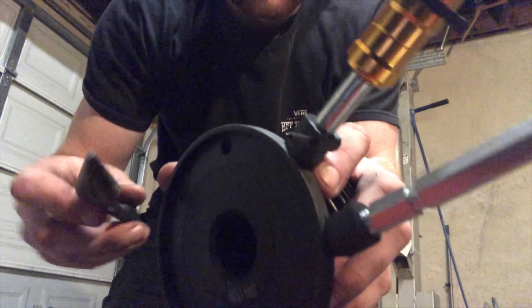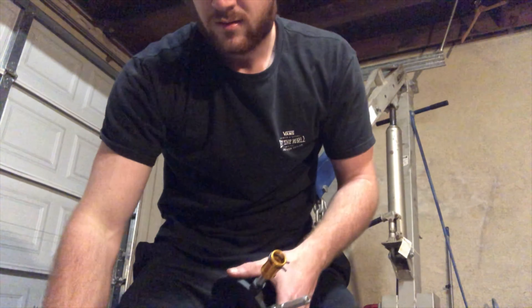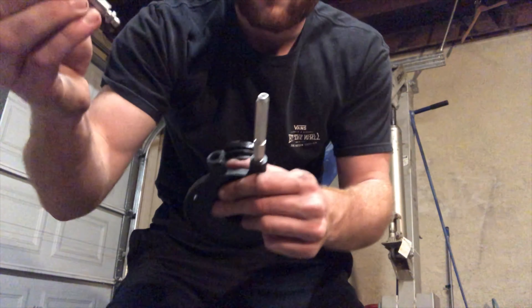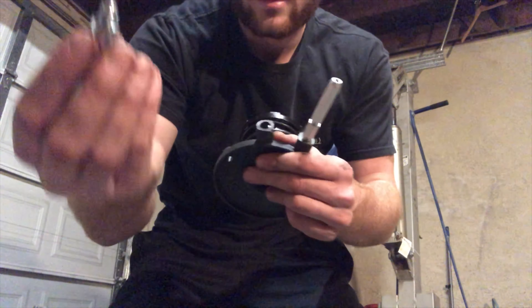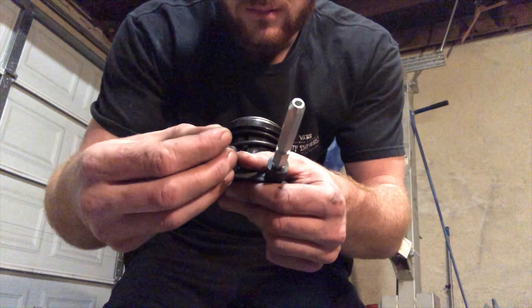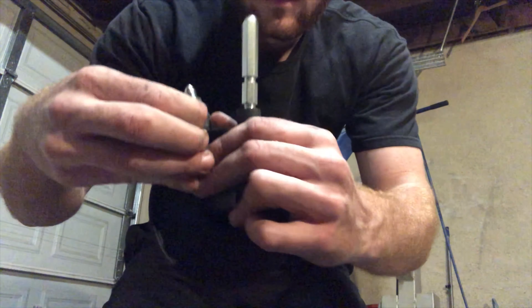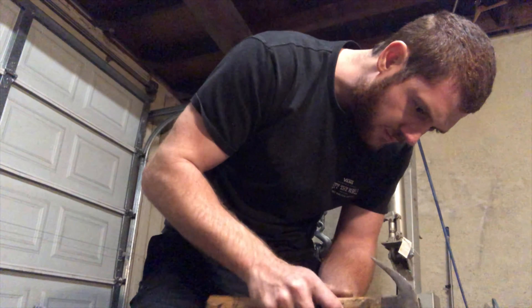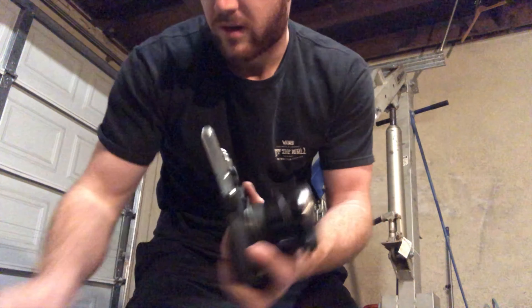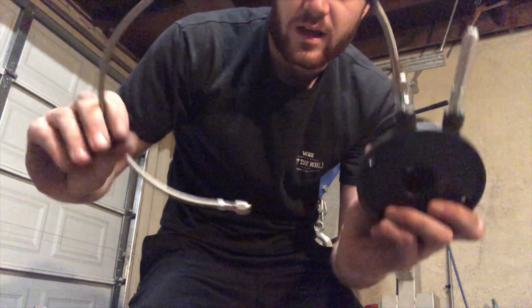I have the pin almost out — it gives a better look so you can see where it comes from. So this should just pop out. Take the adapter and go ahead and pop that in. Once that's in, just replace the pin and hammer it back through. Now I can use a Dash-3 line and send this all the way up toward my master cylinder.